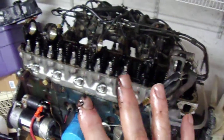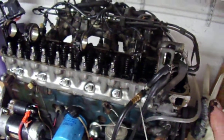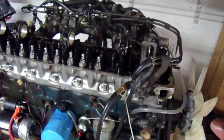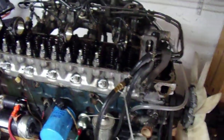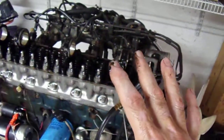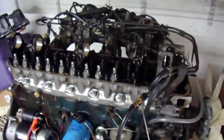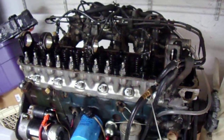This engine's got to be clean. Then I'll run a nice synthetic high-zinc oil — I think Valvoline makes a synthetic high-zinc. I want the high zinc because of the tappets; there's no roller bearing, it's a flat tappet. Synthetic for the heat and the cleanliness, but I have to get the filth out first so I don't contaminate the oil that's going to end up going into the turbo. Anyway, that's it for now. I'm hot and I'm tired, so I'm going to call it a day. Thanks for watching.